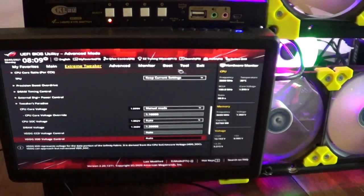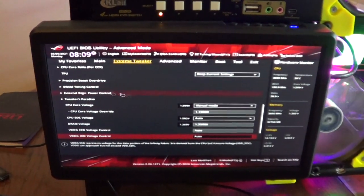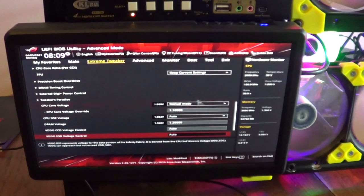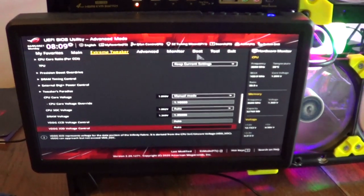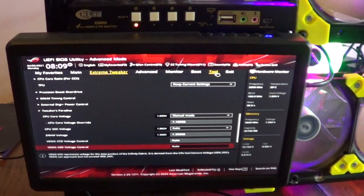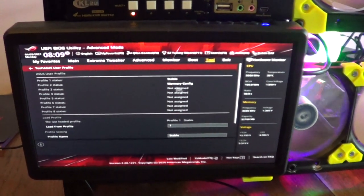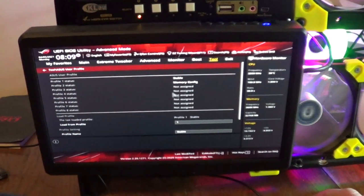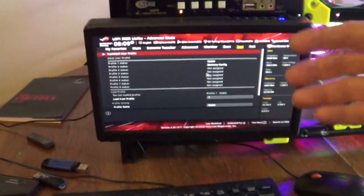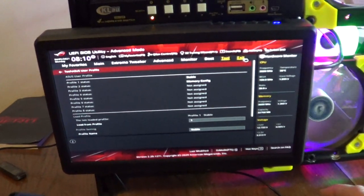And that's basically it. If you want to experiment with overclocking, it's all in the timing control — I spent a week on it and deemed it not worth it. One nice thing on these boards: if you want to overclock, you can use the settings save tool. You don't need it unless you're tweaking, but it saves a lot of time when the machine is unstable. There's also a safe boot button to get your machine back working. A 17,500 hash rate is decent.